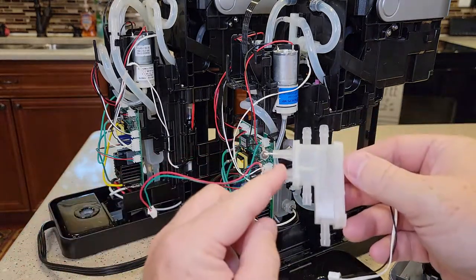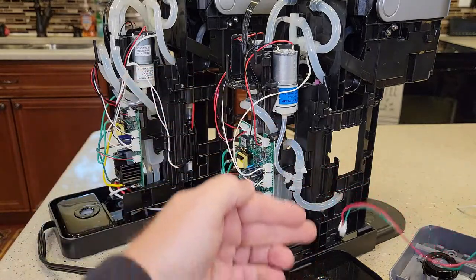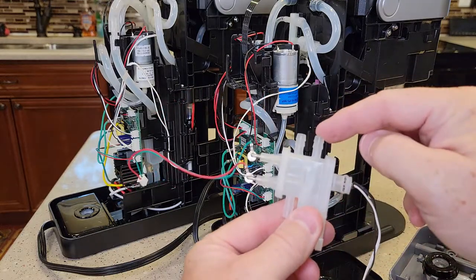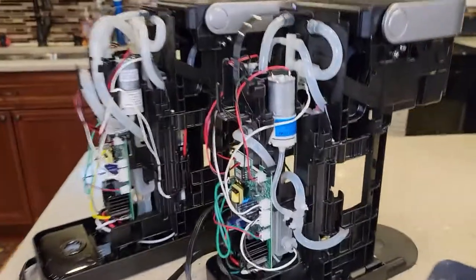There's this box — this is for water quantity. This gives you your add water light. The water goes up in the box as the reservoir. So when the reservoir is installed, the water goes up in the box from that tube. This is the other tube that goes to the intake of the water pump. That's kind of like a pressure switch, but they both are identical with that same box.